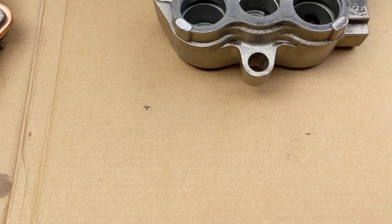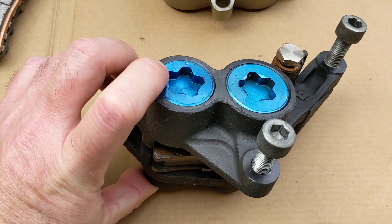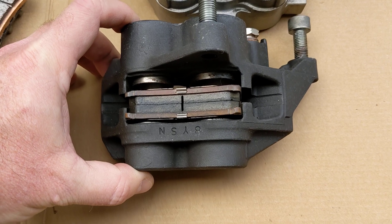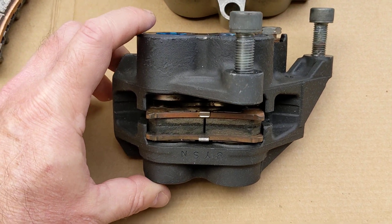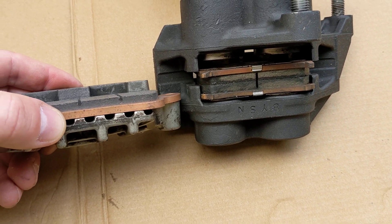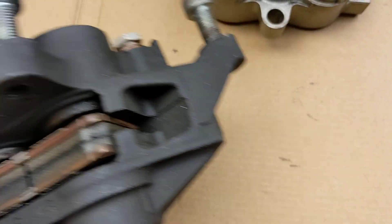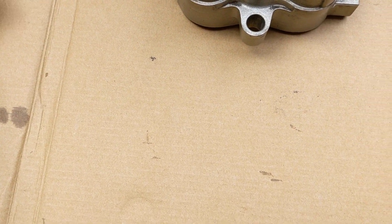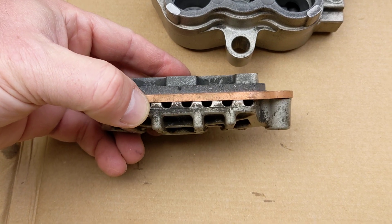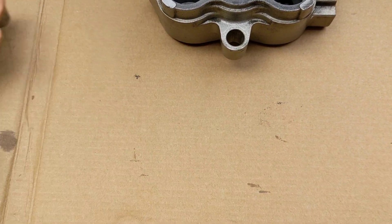I did think about running a four-piston R6 unit — that's a 27 and 30mm four-piston caliper — but the backing on that caliper is way too deep and interferes with the wheels, so I can't use that caliper at all. Instead, I'm going to use this three-piston, which is basically the same design as the two-piston. It's a floating caliper.